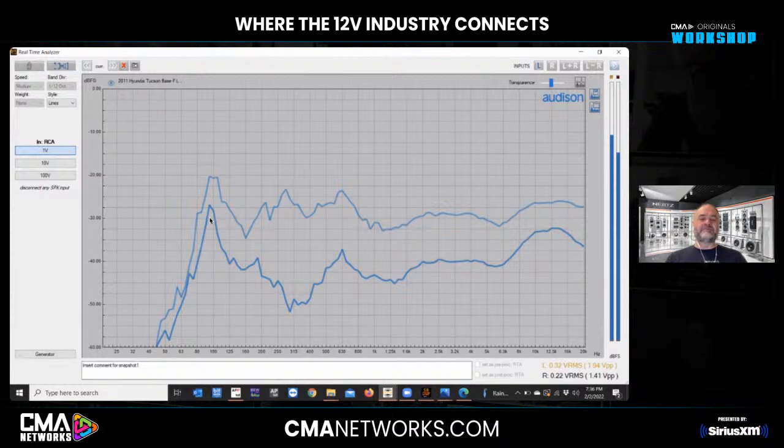This was just a DAC power system. It didn't have much bass below around 60 hertz. So we actually use DEQ on this, but you get the best results in an application like this with an external volume control, leaving the volume at the factory radio at one particular level, tuning for that level, and telling the customer, hey, this point right here is where it's going to sound its best.